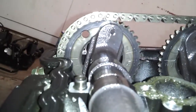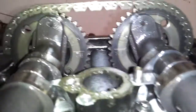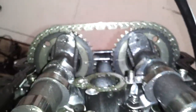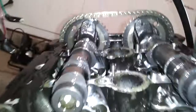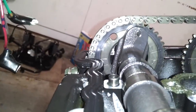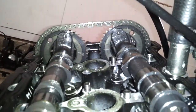Right now you can see that's still set with cylinder number two at top dead center. The way everything up in here lines up — you've got a triangle that forms with these lines in the center, and then the lines on each side are running at the same elevation with the edges of the case. The way the book tells you: spin this around top dead center one more time so that these lobes are facing outward not inward. Where you see the IN and the EX, those will be on the outer edge.